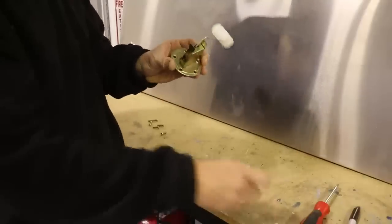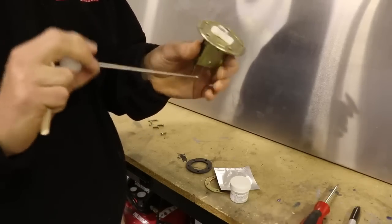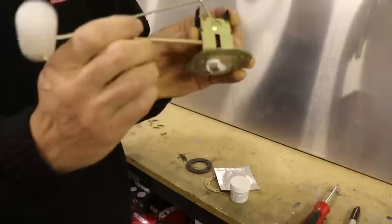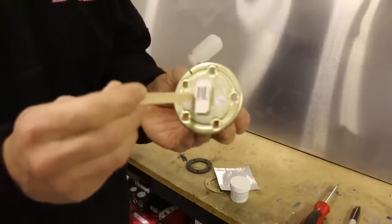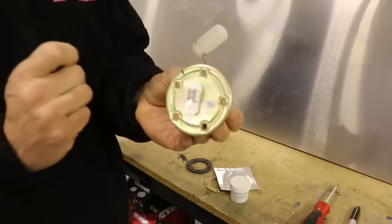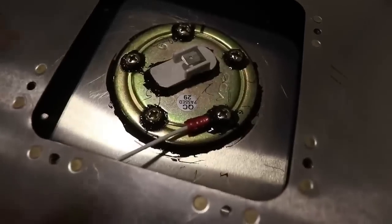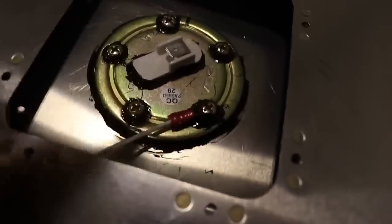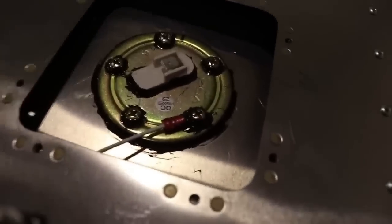One of the things I wanted to point out is this has a metal contactor that goes through here to read the resistance — it's basically just a big potentiometer. Where this goes through, I'm going to put a little bit of Pro Seal around there just to help prevent any possible leaks. Then I'll put Pro Seal all around the perimeter and all around the screws. You can see on my right wing tank that's already done — Pro Seal around all the screws, around the perimeter, and then all around the outside. That's the exact same thing I did on the Cruiser and I don't have any leaks on that one.